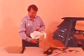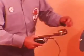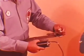Now let's get into quarter glass windows. Incidentally, power windows are required with operable quarter windows. The quarter window mechanism is a new design. For example, here's the regulator. Notice the arm is hinged. This is necessary to accommodate the movements of the slider in a confined space.